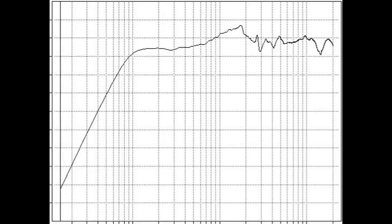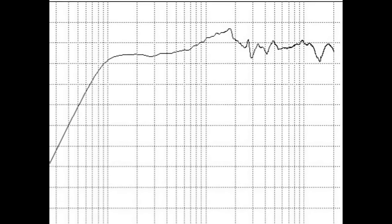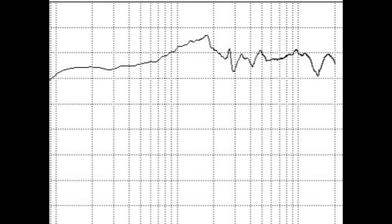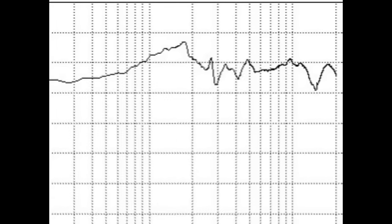The original NS10s were released in 1978, mainly as consumer hi-fi speakers — not studio speakers, consumer hi-fi speakers. In regards to the sound of the original NS10, it had a frequency range of 85 Hz to 20 kHz, but had a roll-off beginning at around 200 Hz, and a 5 dB boost at around 2 kHz.